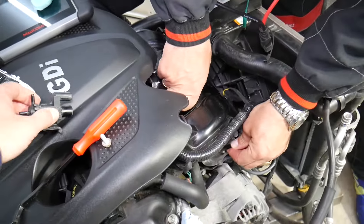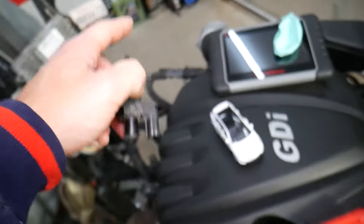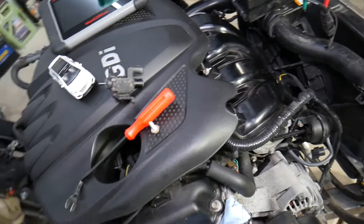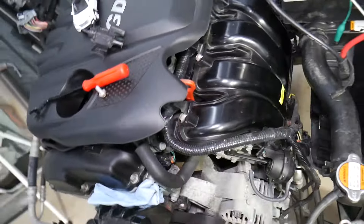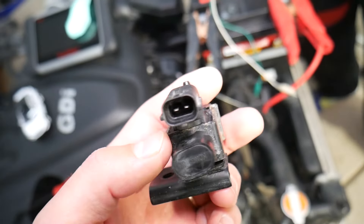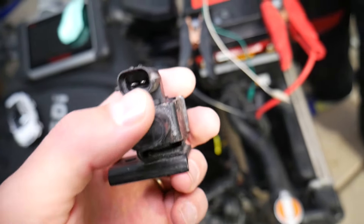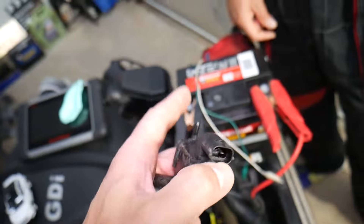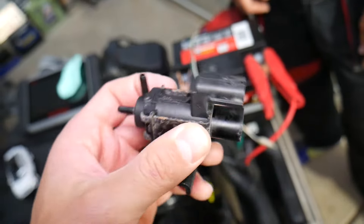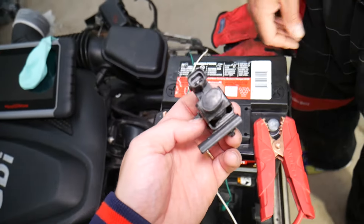Even when the engine is turned off, if that valve checks out fine, I'd always recommend checking your one-directional valve and hoses first to make sure you don't have a vacuum leak — that's the number one reason for these things not to work. Number two would be a bad solenoid. To test the solenoid, it's pretty simple: you have two wires, one positive and one negative, and you can switch them as long as you don't touch the two wires together while connected to a 12-volt supply, because if you do, you'll burn it and need to replace it.